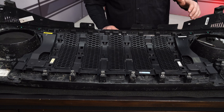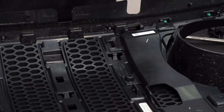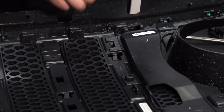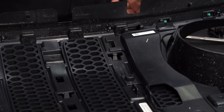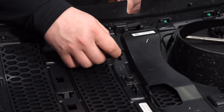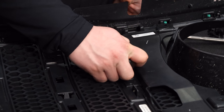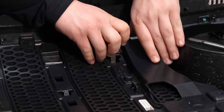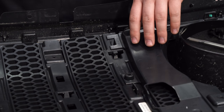There are a few plastic retention clips that need to be popped off — two over here as well as a few throughout the inside. Start with the top corner where there's an overlapping plastic piece — make sure that's pulled over the top. Grab the flathead screwdriver, go in between the grille cover and that piece, pop it towards you, give a little pull, and repeat that process on all the rest of them.